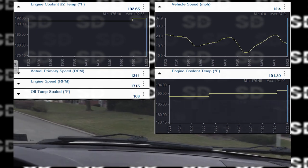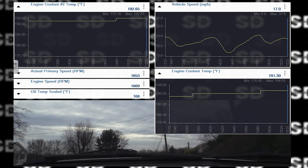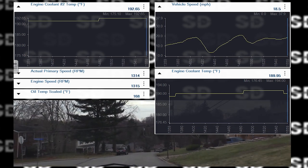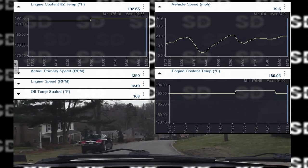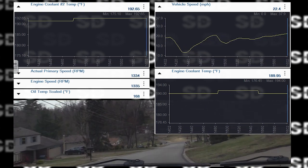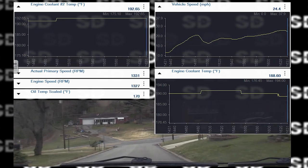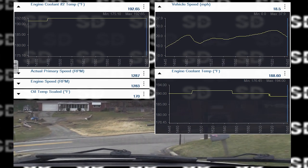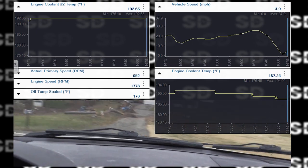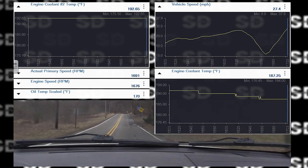This is one of those cars, it's like, if this is my customer, where do you start? You got a power steering whine, so you have a leak. You have a light throttle surge. You have someone that was in here messing around with the cover. Why was the intake air temp sensor unplugged? When did the check engine light come on? There's just so many different things potentially wrong with this car, and I know nothing about it. Pete's like, oh, look at this car, there's a check engine light on. No, not good enough.